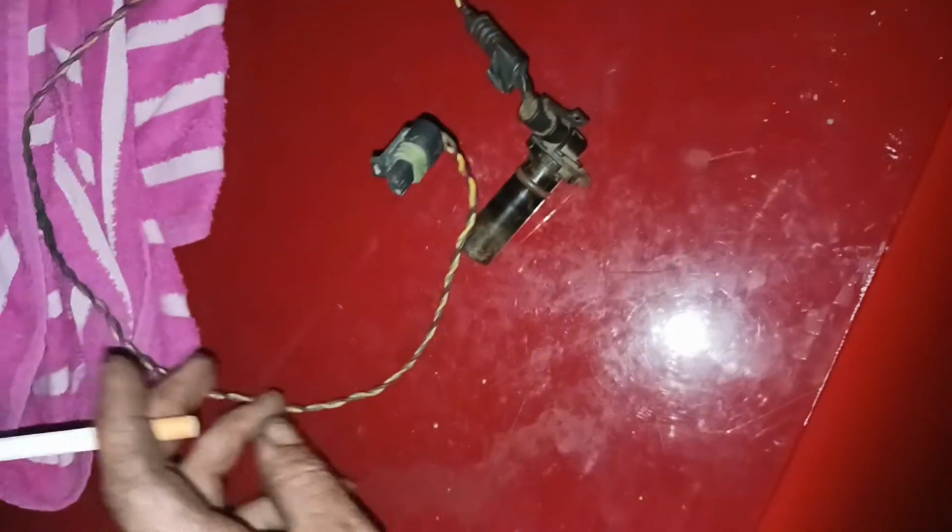Alright, so now I gotta move this thing into the driveway so I can, oh, damn oil jug. Yeah, I gotta swap out this other crank sensor. I did not know there was 2 crank sensors on the 3.4. And so I've changed the crank sensor behind the crank pulley twice now on my mom's car, and it's still throwing a code. As you can tell, these wires run from the coil pack on the top side at the back of the engine down, and this sensor is bolted right in the back side of the block.